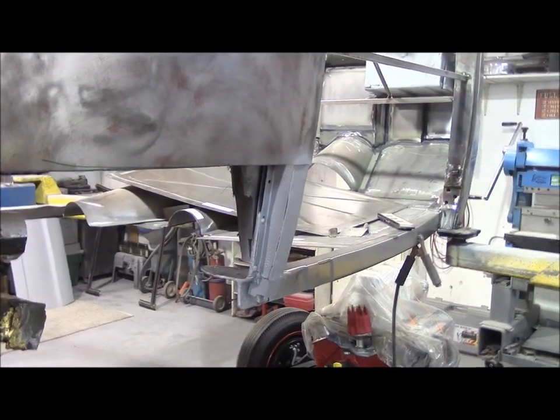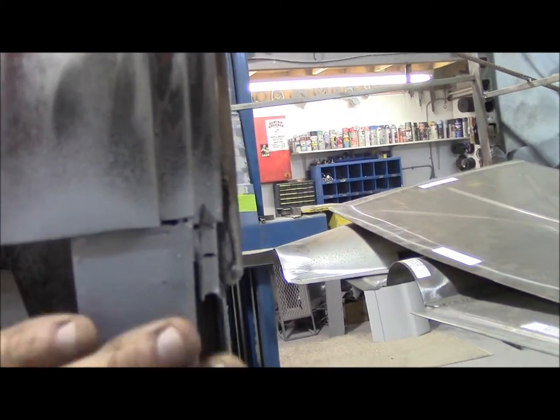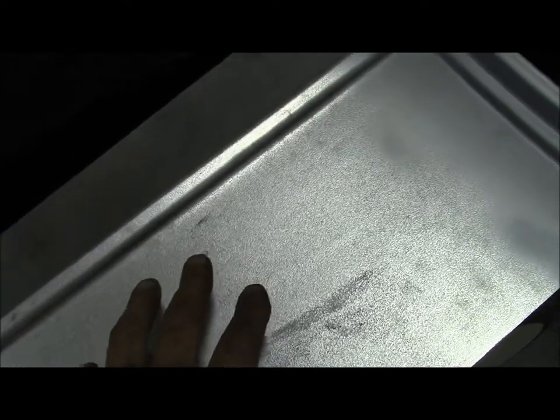I have put on my weld-through primer because that panel goes right up against it, especially right in the lips here. Now I've done that little bit of rust repair behind there — I put that little piece in there, it was only maybe an inch, inch and a half. I could have just cut it off and left it and who would have ever known, but it was there for the factory and it was there for a reason. So I put it back and fixed it. Whether Dan can ever see it or not doesn't matter — at least if anyone ever digs into this car, they're going to see that it's how it should be.